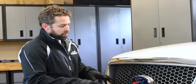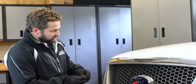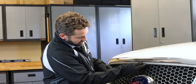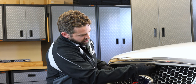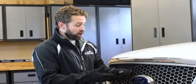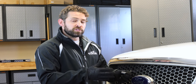Now that we've got our lights run through the grille, grab your included cleaning pad and make sure the grille is clean from the get-go. If it's too dirty, clean it with something else first — you want this to be your last step for the surface adhesion. Wipe each of your sections really well. Now remove the red protective layer from the 3M adhesive. This adhesive is extremely strong and built for automotive purposes. Once it cures for about 24 hours, you're fine to take it through car washes or any kind of weather.